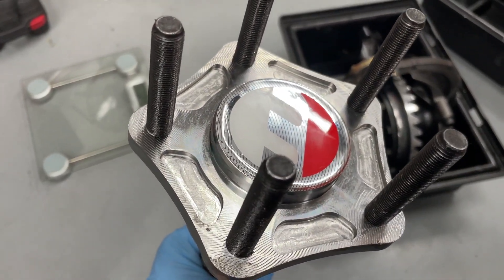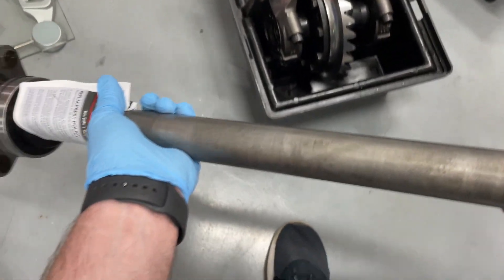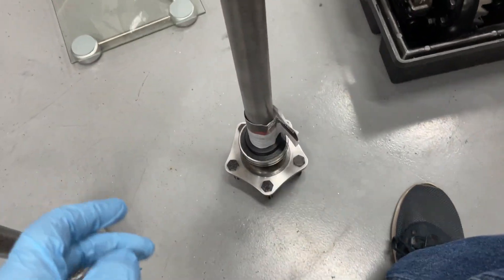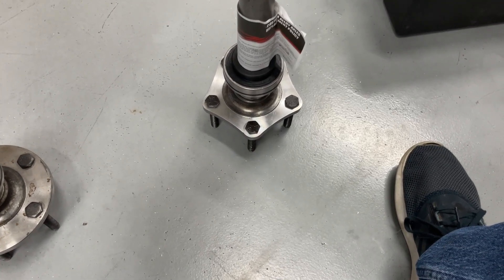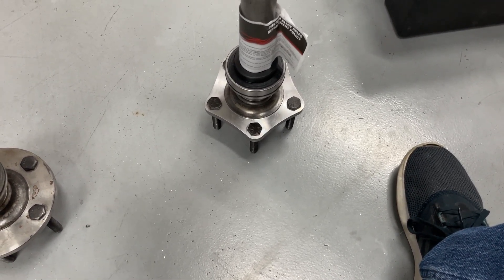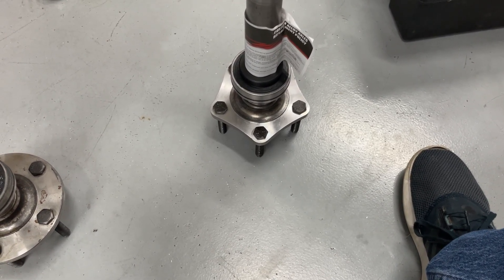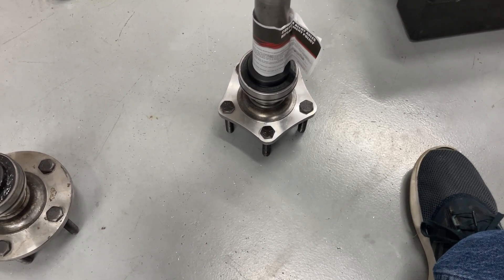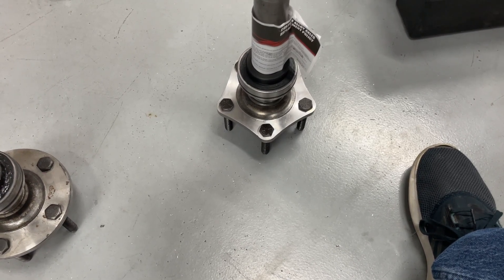This is the standard flange and that's the lightened flange. From this perspective you can see where it's been milled out, so it's lighter. These are half-inch studs, same as the old ones. Some of you might be asking why not run 5/8 studs — the biggest reason is that some wheels, like the ones I'm running, will not work with a 5/8 stud. I've tried. I don't think the half-inch has anything wrong with it at this power level anyway.